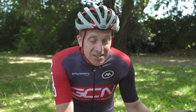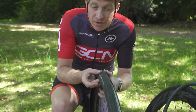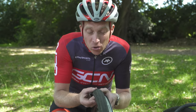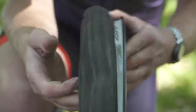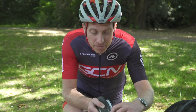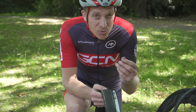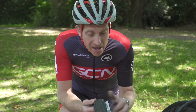One final check before reinserting the inner tube: gently and carefully run your fingers around the inside of the tyre to find any foreign object that may have caused the puncture. Also check the rim tape to make sure all spoke heads are fully covered, the spoke nipples too, and pay particular attention around the valve, because on an aluminium rim that area can become a little bit sharp and wear away. If you do have a puncture near the valve, they're often very difficult to repair properly.